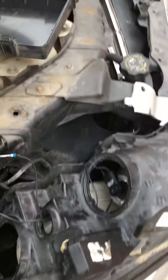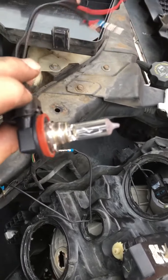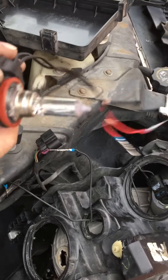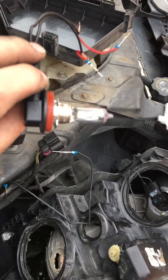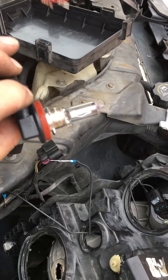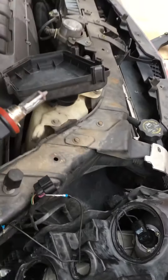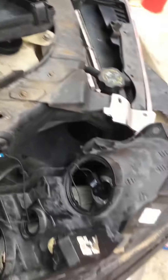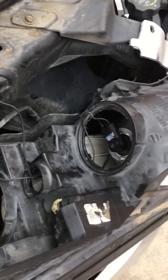Here's the problem I was having: I was using higher luminosity Sylvania bulbs in my Traverse, and the pigtail plastic would burn out and the light bulb would go out. So I'd have to replace both the bulb and the pigtail. The Sylvania ones put out a lot of power, so they can't really handle it for long — maybe five to eight months on average. But it's worth it for the brighter light.